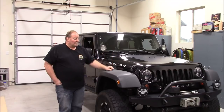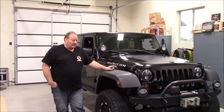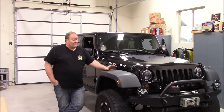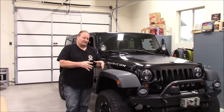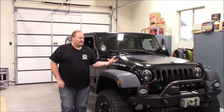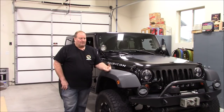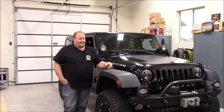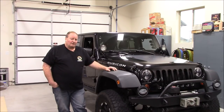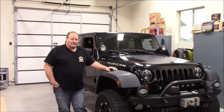One other thing: I'm going to pull my PSC XD2 gearbox — it's performed great, I love it on and off-road, handles the 35s great — but it's such a physically large box that I can't fit it and accommodate my AC compressor, which it's encroaching right into the area where I want to put my factory JK AC compressor. So I'm reinstalling my factory steering gearbox, which I've had West Texas Off-Road port and tap. I bought their one-and-a-half-inch ram and I'm going to run hydro assist. I only want the 1.5-inch because this is my daily driver — I want to keep it very streetable and drivable, just with a little extra help turning the 37s when I'm wheeling.